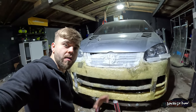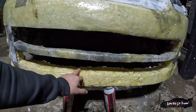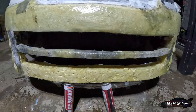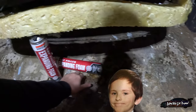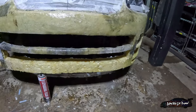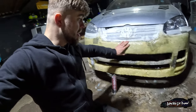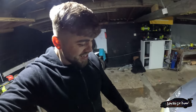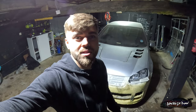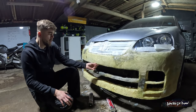All right, this is how far I've got with the bumper today. Everything's fiberglassed now apart from the bottom bit where I've just used resin on it. My idea is this should be firm enough to actually hold the foam up — I don't believe it's going to need fiberglass but I'm just trialling it so hopefully it should be all right. Tomorrow I'm going to come back and fill the bumper, but first I'm going to have to get rid of the high spots caused from the fiberglass. So this is the end of the video — thank you so much for watching and I'll see you in the next one.